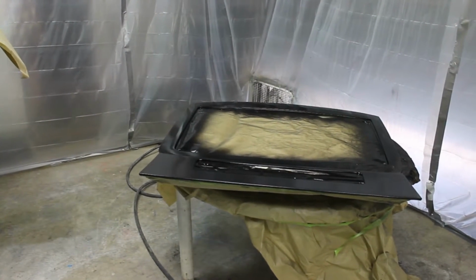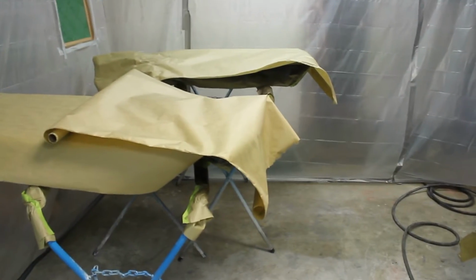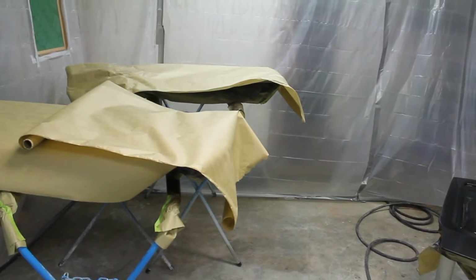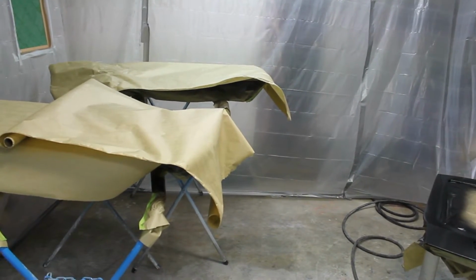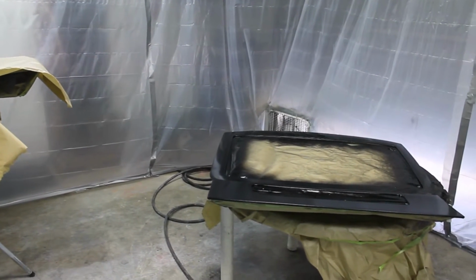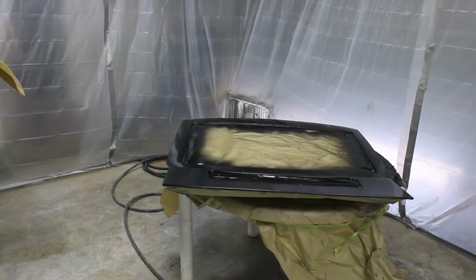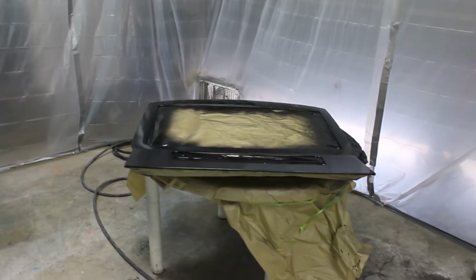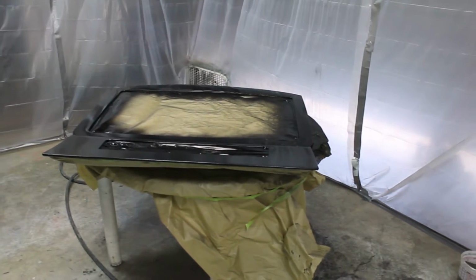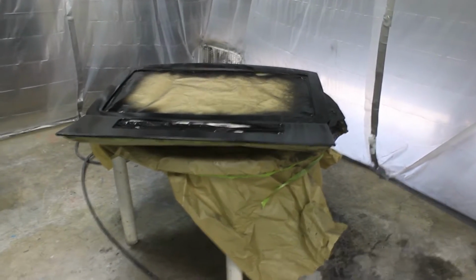You know, the first paint I put on there had fisheye eliminator in it. So all of my equipment has it in there. It's embedded in the paint that was on there before. So I think I've got to use it from here on out. I'm trying it again using the fisheye eliminator, and I put it on wet and they start to appear again. So I'm just trying some really dry coats right now.